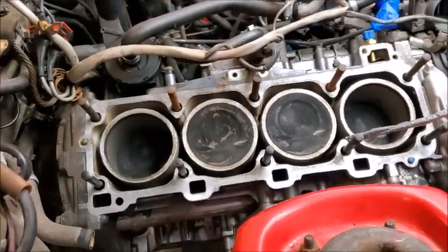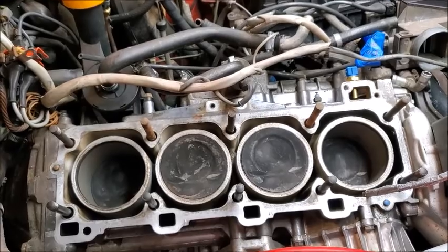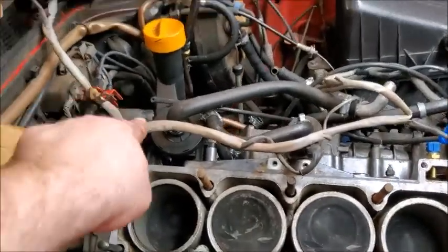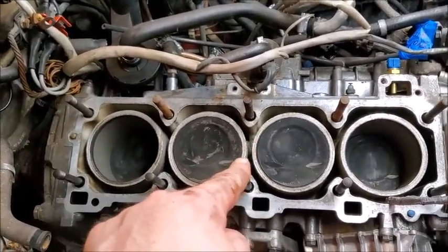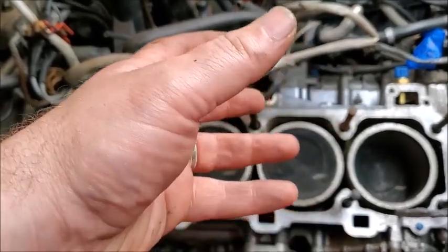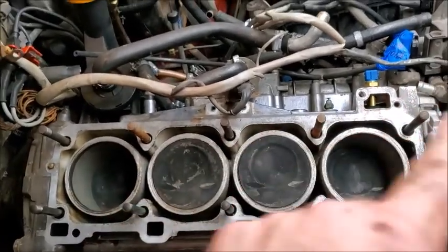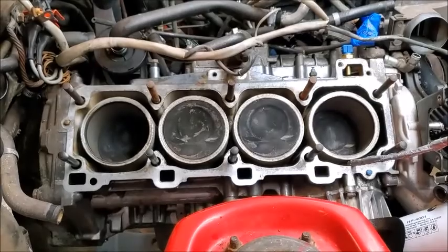So when you go to rotate it again, any little junk or anything isn't sitting in there, and then I'll wipe it out with a clean oily rag too before I rotate it, because what I'll do is I will put this back at top dead center. I bought a paint pen so I can mark my OT mark then, because it's really hard to see because it's rusty. So I'll do that, and then I will put everything at mid-stroke, so when I put the cam tower on, I can rotate it as much as I want and let those valves open and close, because they will not hit the pistons because it's at mid-stroke. Nothing's at top dead center. Then once I got my cam at top dead center, I'll go ahead and rotate the engine again and get this at top dead center, and then I'll go ahead and start doing my timing belt and everything. But at least that way I know the valves can't hit the pistons when I put the cam tower on. So there you go.